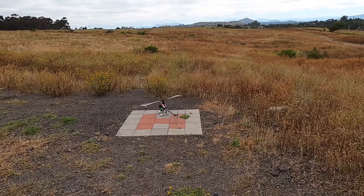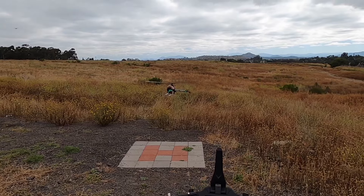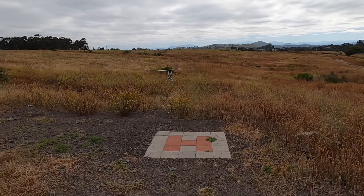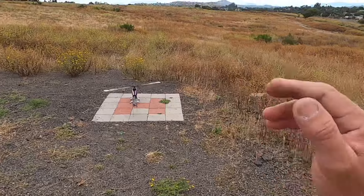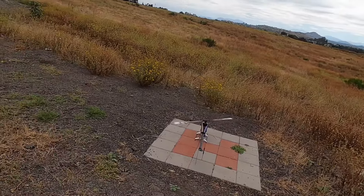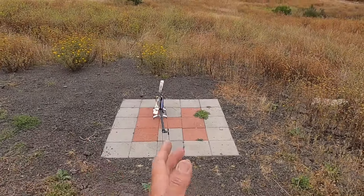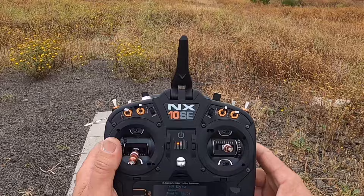I had it set pretty good. Getting up in the air - see how it's rotating to the left, but barely. I would call this a good position to have my tail rotor - it's in perfect sync with the mechanical adjustment. If I didn't have that pushrod perfect the helicopter would want to rotate its nose left or right. When we fly we're not looking at the tail - we're looking at the nose. Remember rookies: nose goes right, tail goes left. Know your geometry.